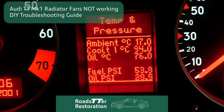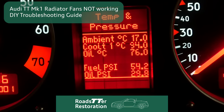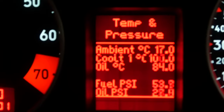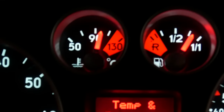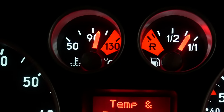Next is a very common issue for a lot of Audi TT owners: radiator fans not working. I've discovered that the TT overheats and the radiator fans don't seem to work properly. You can see that as the car gets up to temperature, there's no cooling action and the temperature just keeps creeping higher and higher, moving the needle from its normal 90 position. I can't let it go anywhere until this issue is resolved, so what options are there to figure out what's going on with the radiator fans?